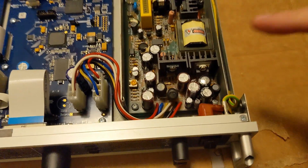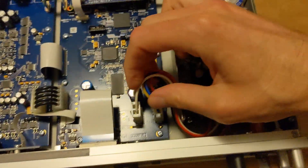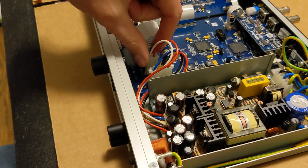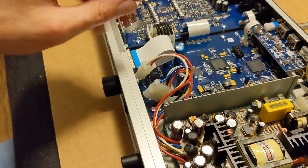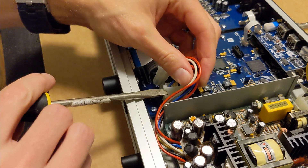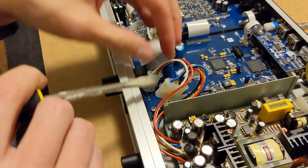This is the power supply. It's hooked up by a ribbon cable, so we have to disconnect both of these and then we'll be able to take this power supply out and work on it. These cables are really hard to get disconnected from this board, so you might need to use a needle nose or something. What I used was a flat blade screwdriver — I literally just propped it up and popped it off using the little tab. I felt like I was going to break the board, but I just put my finger there and pried it and they popped up pretty easily.